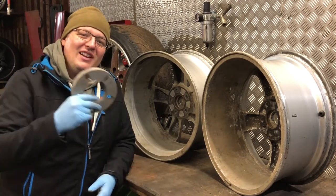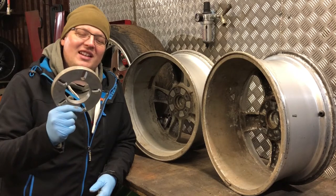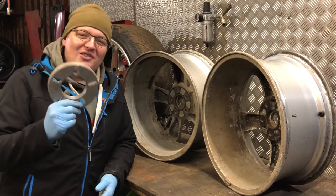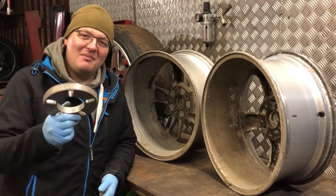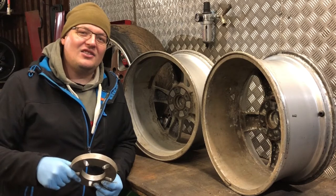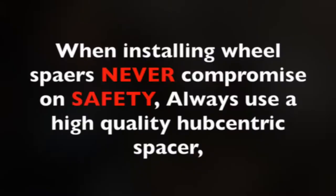On a slight side note, these spacers are probably the world's worst thing in the world, but they're the only thing I had about to try and demonstrate what we were talking about. Do not, under any circumstance, use 20mm slip-on spacers. 10mm slip-on spacers, you can probably get away with 5mm, but anything above that, you're going to need extended studs. These are junk. Like an LS1, I suppose.